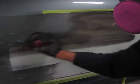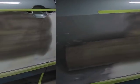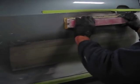Again, we apply our dry guide coat to the entire area that we've just sanded. Blowing off the extra guide coat, we're now ready to sand. Again, with the 150 grit on a hard block, we're moving across the areas that we just filled, and they are very obviously filled and have the correct shape.